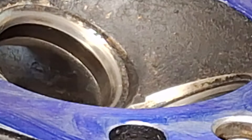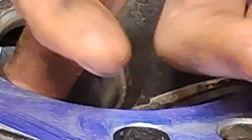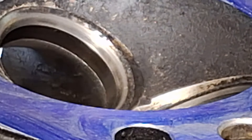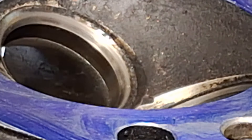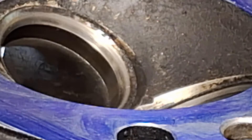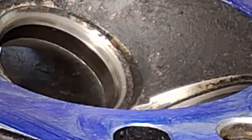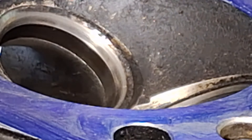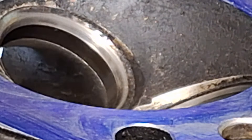Regardless of that, we'll blend those in on the intake and exhaust side and fix these ports up. Down inside of here they're a little rough, they need some reshaping. And I'll cut the guides down slightly. My limit on the guides — I think I measured them — you want to run five to seven times the diameter of the valve as a safety margin for the valve guide length. Five to seven times 0.312 gives a length of basically 2.2 something. These are 2.4 something, meaning I can take two hundred thousandths off these guides to help them flow a little better.